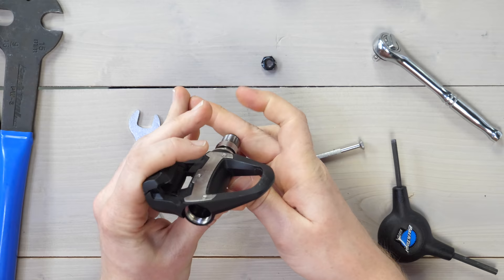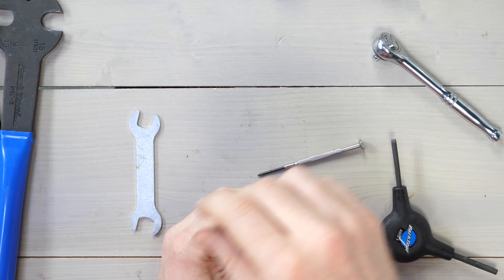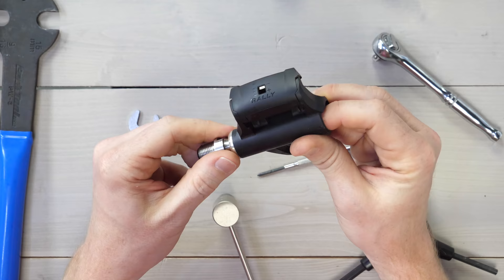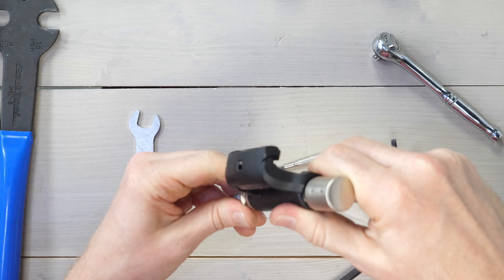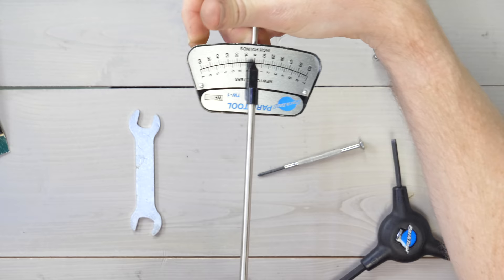On the back side, take the black nut — top-hat side down into the hole. It's a little bit trickier on the SPD-SL because it's a little deeper down the hole. Just spin it until it's tight — it's really that simple. Get it snug with the wrench, then torque to 10 Newton meters again. And we're done with that.